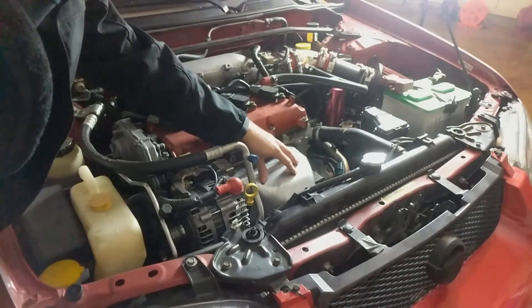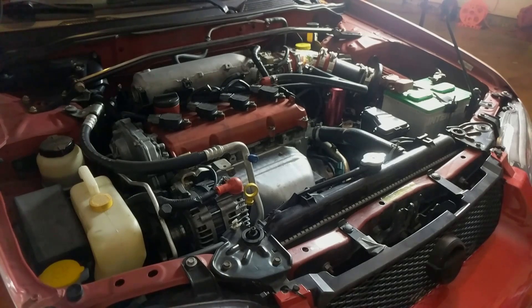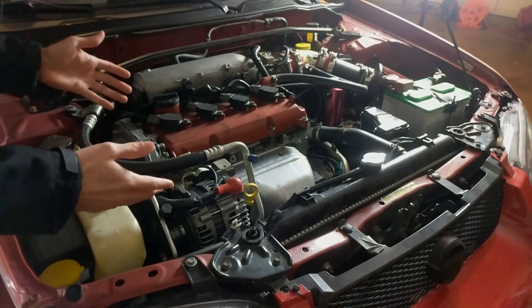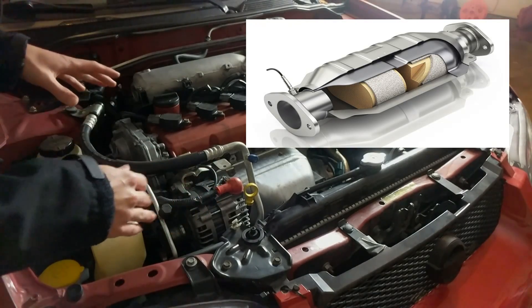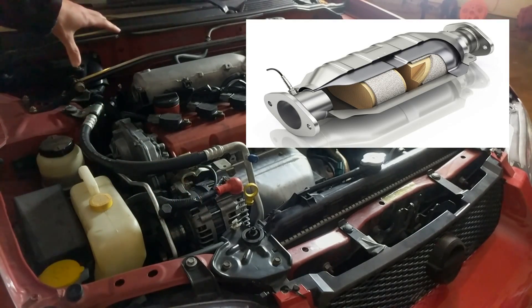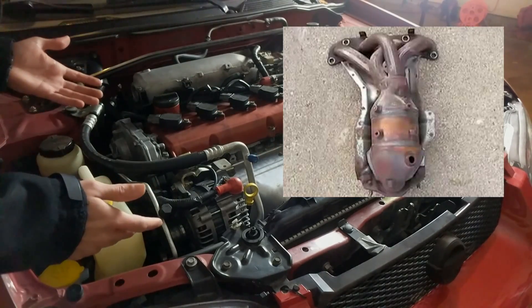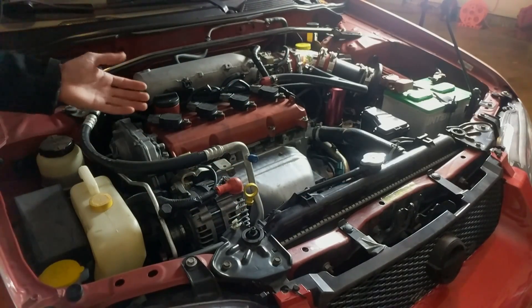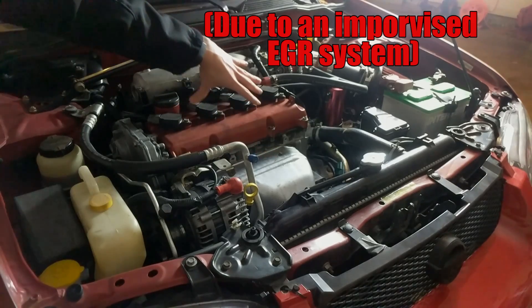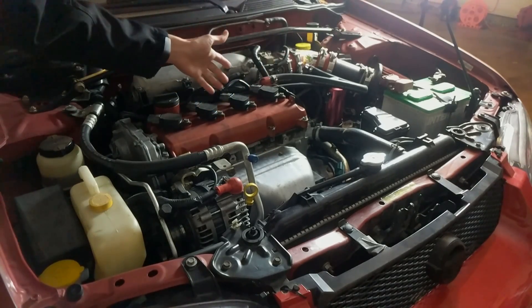The first issue has to do with the factory exhaust manifold found on the engine. My car still has the stock exhaust manifold because it has the standard heat shield on it. Back in 2002 when Nissan was first designing this engine, they wanted it to be as low emission as possible. So while they also have a standard catalytic converter back in the exhaust system, they put a pre-catalyst material inside of the exhaust manifold. That's why when you look at it when it's removed from the car, it has a bulge in the middle of it to hold all that pre-catalyst material. Once the pre-catalyst starts disintegrating, it can actually go back inside of the engine and destroy the valve train and cylinder head by putting these particulates inside of the oil.